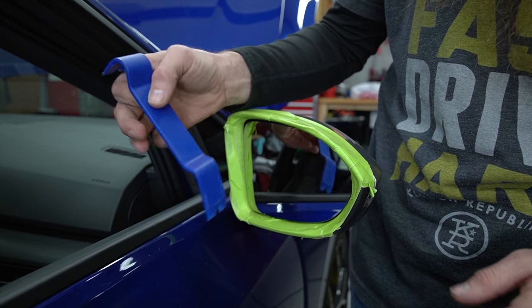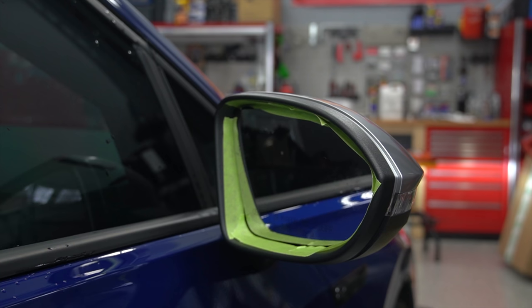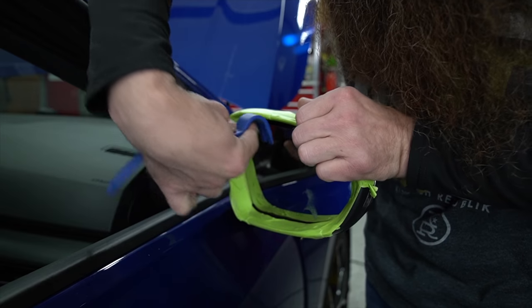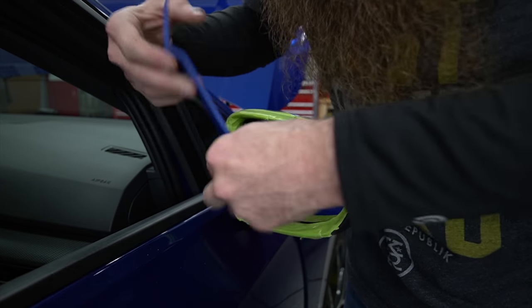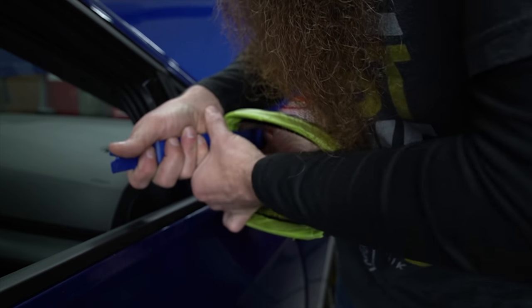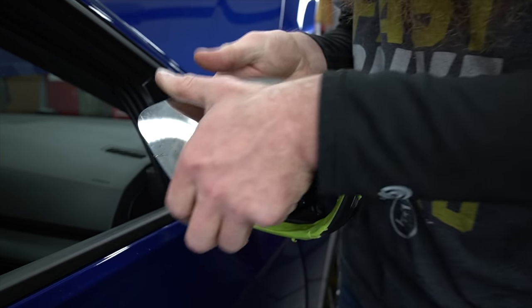And here is where the job went a little bit sideways. What you really want to do is lower the mirror glass all the way down or out to one side — this gives you quite a bit more room to get either your hands or the removal tool behind the glass. On the first time removing the glass it's gonna be on there super tight, so be extra careful. Make sure you pry only, instead of rotating the trim tool — which is what I did. And here is the result of that. I broke it. That's what you don't want to do — break your mirror glass. Good job Charles.